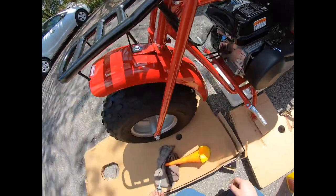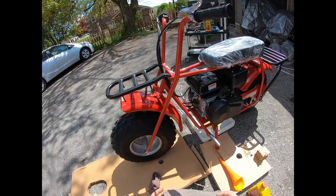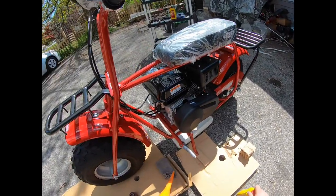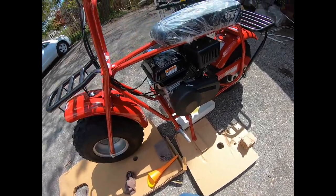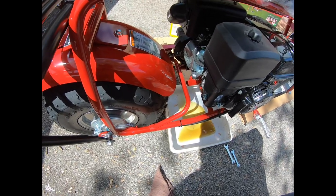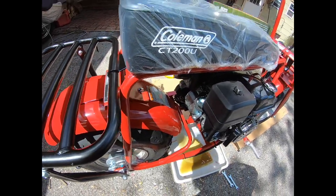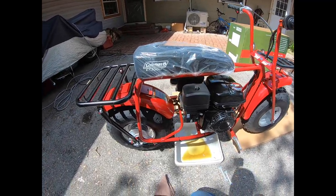So what I'm going to do is leave that valve open and use some of this fresh oil to flush some of that stuff out, just because it's assembly oil and we don't know how good it is — and we don't want to find out the hard way how bad it is. This stuff is all nasty. So I got two quarts here, this way I can run it all, put a couple hours on it, and then change it out for some more fresh stuff. Keep it running nice and clean, this way it will last as long as I need it to. Eventually I'll probably throw a Predator on it — probably a 212. I don't know, I guess we'll find out, but that's all to come.